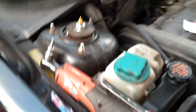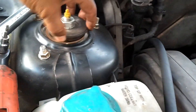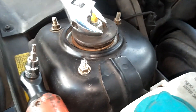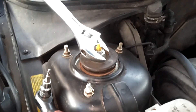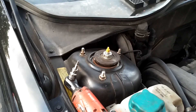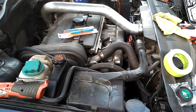Byron mentioned he was experiencing some suspension discomfort. The spring seat on one side looks okay, but the other one looks off-center. You can see the lip on one side but not the other — this spring seat is totally torn through. You could probably turn this nut all the way around with the rubber turning with it, which tells you the spring seat is torn away. This is going to cause banging when he hits bumps and will feel unstable. Since this car has adjustable coilovers, you really need to get stuff like that fixed. I'll order one of these tonight and hopefully get it replaced.